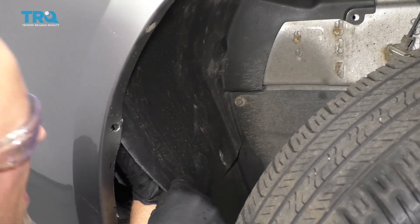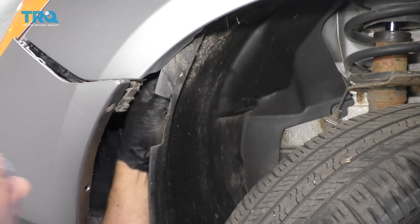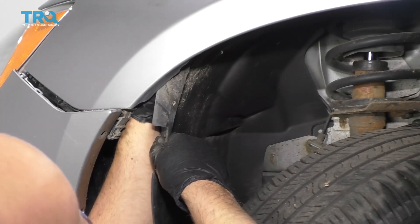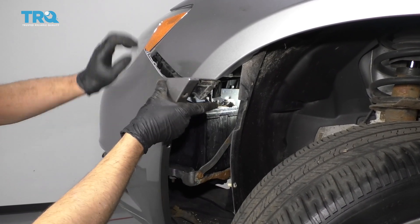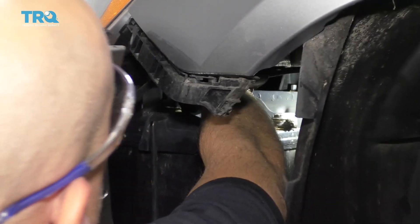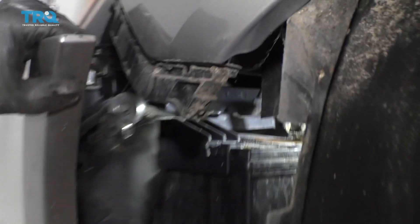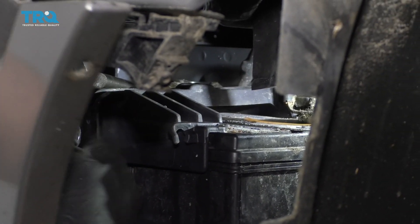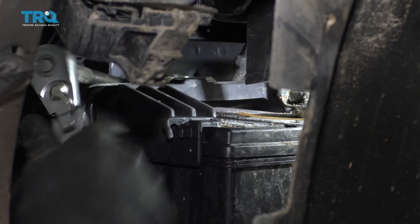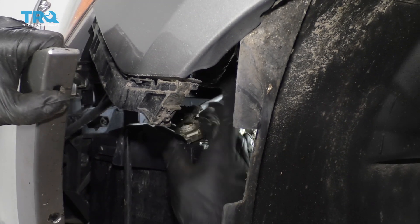Move this panel back and grab the bumper, slide it over and pull this piece of the bumper out. You can access the negative battery terminal right here. Take a 10-millimeter socket with an extension and disconnect the negative side. You don't want to disconnect the positive side — it's always better to disconnect the negative side so you don't arc anything out. Loosen this up, grab the terminal and wiggle it up and out of the way.